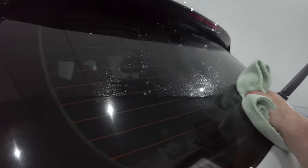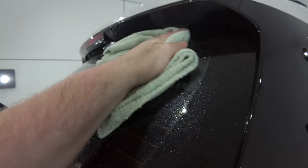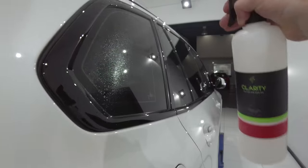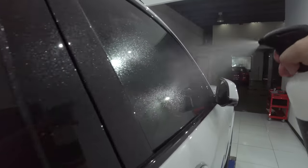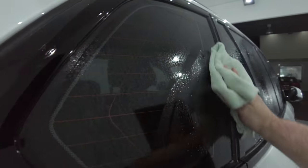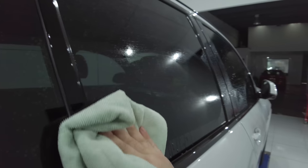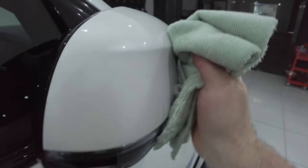After a comprehensive decontamination process, there's always going to be some remaining detergent and chemical residue, as well as some mold dust, dirt and water smudges and streaks that get kicked up over the vehicle. It's just normal, especially after blow drying a vehicle. So as my goal before paint correction is to have the paint as clean and bare as possible, not only so this contamination doesn't get into my polishing pads, but also so I can do my other pre-correction work better, such as the paint inspection, paint measurement, and masking up the trims without any of that getting in the way.